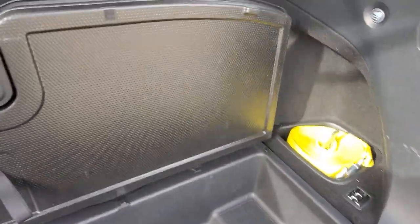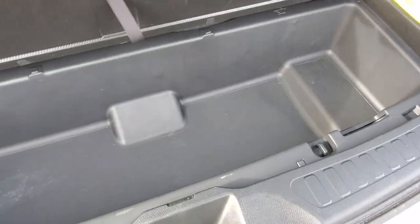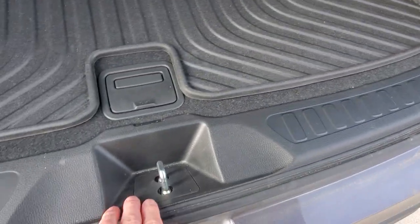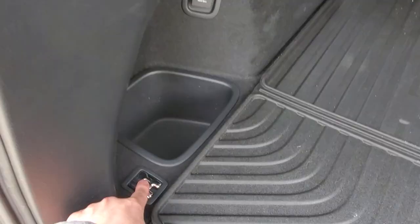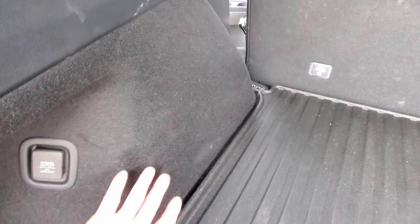It's pretty easy. Basically, you just flip this all the way back, put your seats back, so this whole area is exposed. Then this tray comes out — this tray right here. This is not a how-to video by any means; it's just to let you know that the trailer harness is not that scary to install. That tray came out, and then this little trim piece just pulls up around the hitch — it comes straight off, this whole piece right here. Once you get all that stuff removed, you take off this tie-down and that tie-down, and basically this separates right at the seam here from the side. Underneath this right here, this wheel well, is the harness — this is the connection.